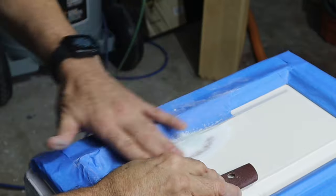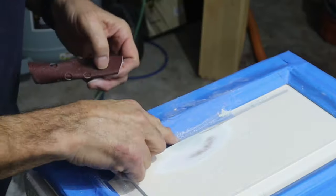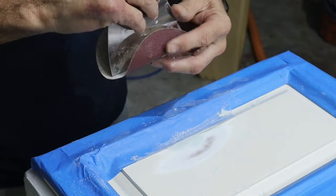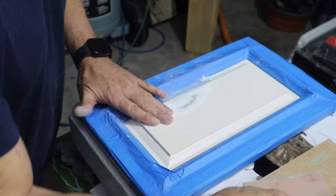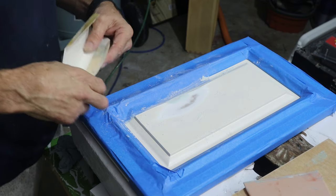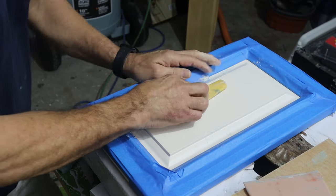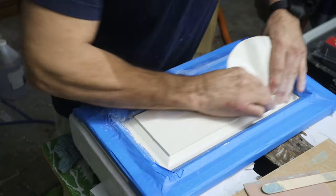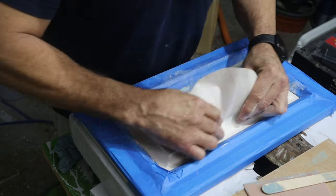I stepped away for a few minutes to let it dry. Now we're finishing up with 120-grit sandpaper again, using a stick to make it smooth and flat. The next thing you want to do is take the edge and make it really sharp — I'll use a blade with my sandpaper to get a good clean edge. All the rough sanding is done, so now get some 220-grit sandpaper and clean the whole area off. Sand the whole panel down with 220 and get it prepped for the primer. Watch your corners — 220 is light but you'll dig into corners if you're not careful, you just want to scuff it.